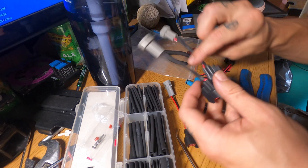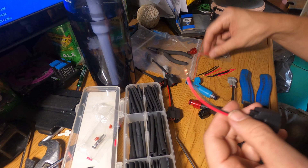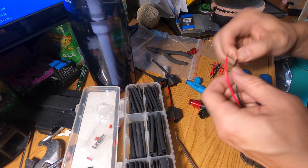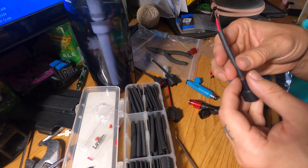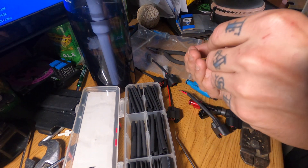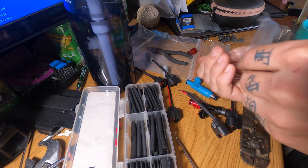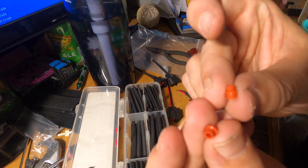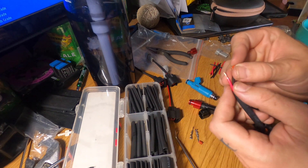To get our harnesses looking good, I trimmed down about two to two and a half inches of wire — measure it yourself to make sure it's correct. Take your heat shrink — nothing fancy, just some random stuff from the auto parts store. These are little weather sealer pieces. I'm going to end up hitting most of the harnesses with silicone anyway, because I'm really anal like that.